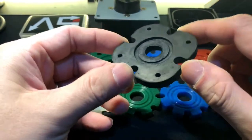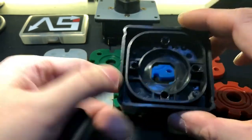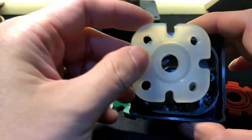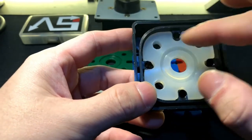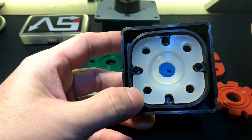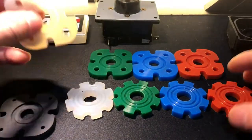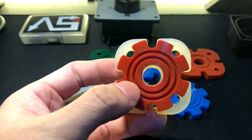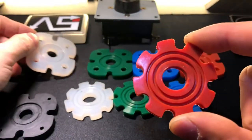This is the original design of Fanta grommets, and on the Fanta case they have 4 pins to keep the grommet in place. The reason there are 4 holes on the corners is because we want to make the tension equal in every direction — not only cardinal directions (up, down, left, right) have holes, the diagonals also have holes so the tension will be equal. Actually, Fanta and Krone share the same design — if you cut out this part you will end up with a gear-shaped grommet.